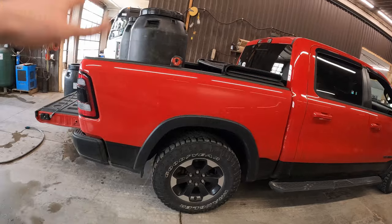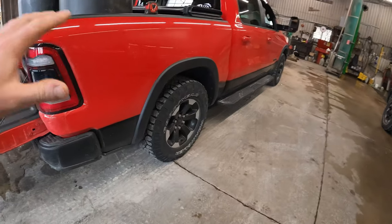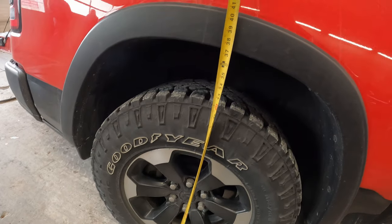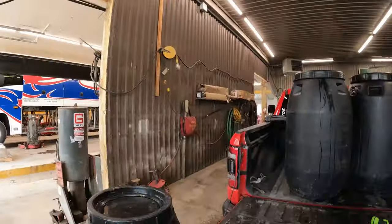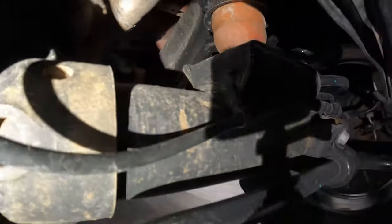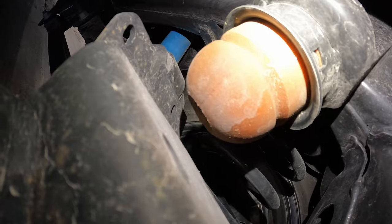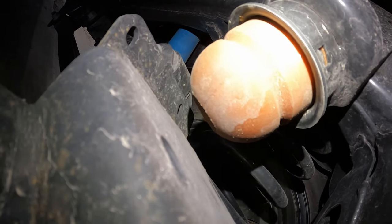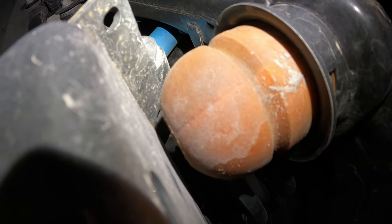We have roughly about 950 pounds — just under a thousand pounds of weight in this truck. We're starting to sag a little bit. We are now at about 37 and a quarter inches, down from 40, so almost three inches of squat — about two and three quarters inches of squat with a thousand pounds. Not too bad at all. Under the truck now, the coils are starting to compress. There's the bump stop, and we have about half an inch until it hits the top of the axle. That third barrel is about halfway full.